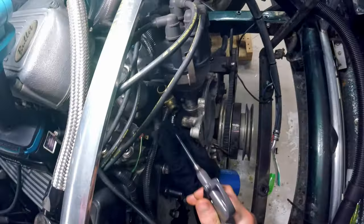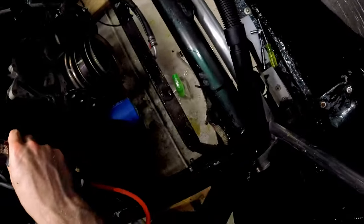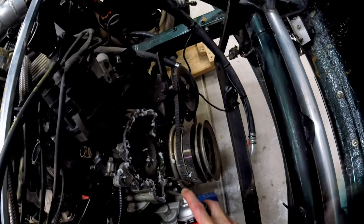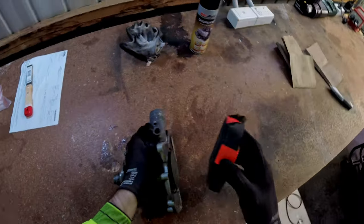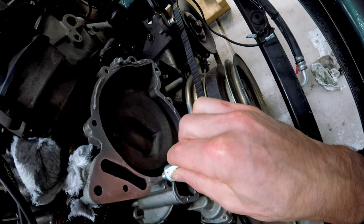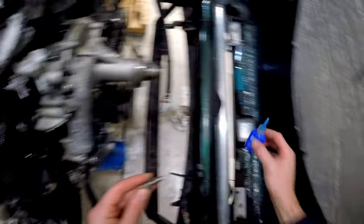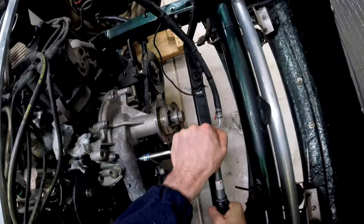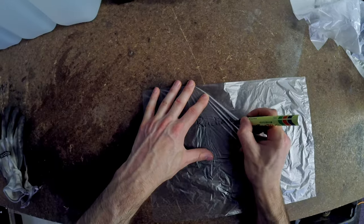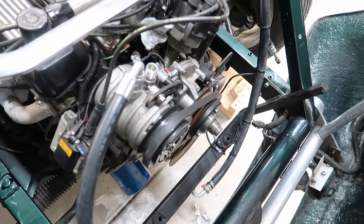Because I was nervous about debris sitting in the engine block, I thought it'd be a great idea to use compressed air — and yeah, this was the result. The water pump mating surfaces got a good chemical clean and received a light sand before I was ready to start installing. I'm using water pump gasket glue and thread sealant for only one bolt which coolant makes contact with. A bit of low-strength thread lock is applied to certain bolts which appeared to have it on before, and everything is torqued to spec.